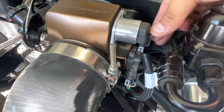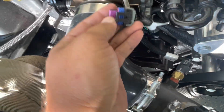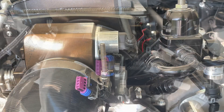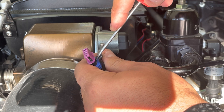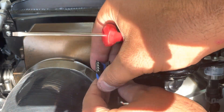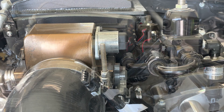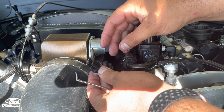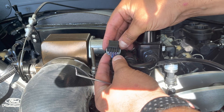We're going to start by unplugging the actual IAC. For those who don't know, it goes right on the side of the throttle body — it's labeled IAC, four-pin, whether GM or Chrysler they all plug into one connector. I'll show you how to de-pin this. First, using a screwdriver, pull away this purple clip — it just pops out like that. Set it aside, don't lose it. Also pull the blue rubber seal off to gain access. Looking at the connector closely, the terminals I'm looking for are A and C. Holley's wiring is posted on their website, which I'll put in the description.